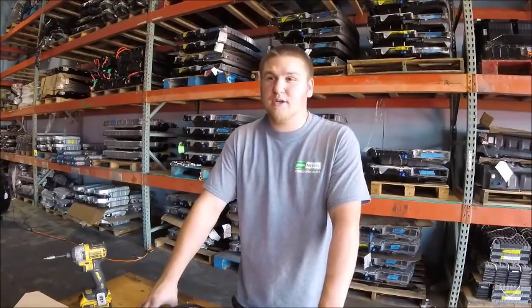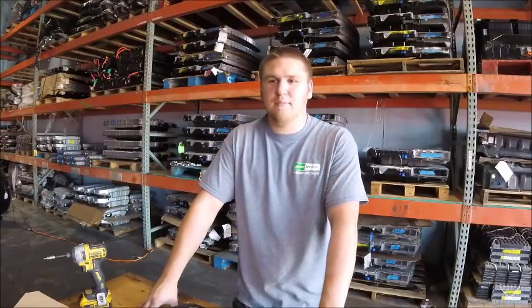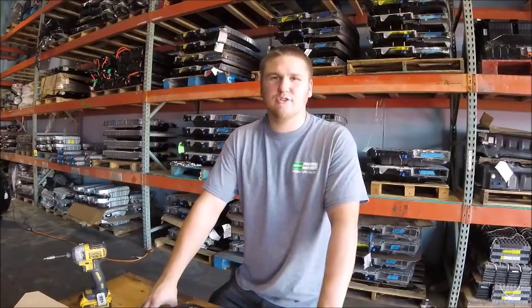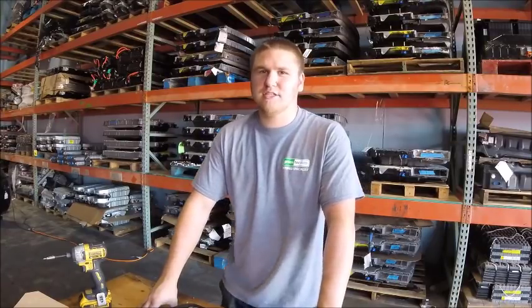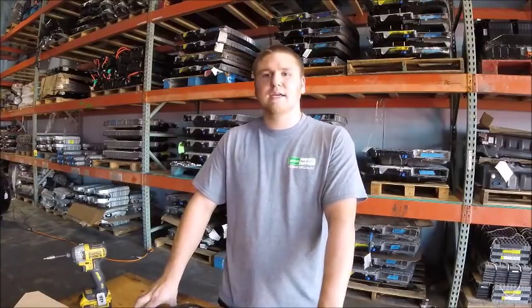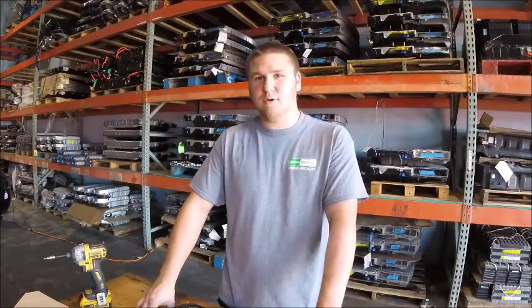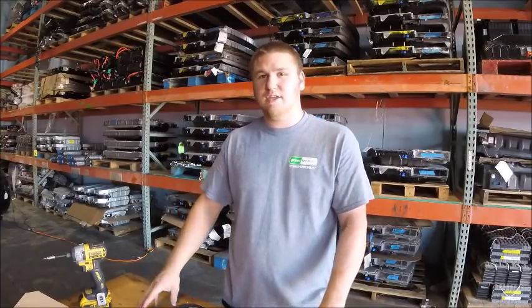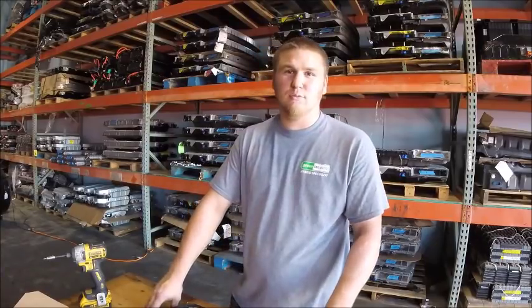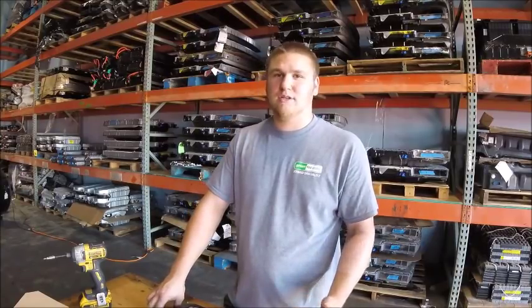One of the questions that I'm going to assume is going to be asked is, why don't I just charge them back up? There's a lot of videos on YouTube that I saw of people recharging Tesla packs and whatnot. And the thing to remember is that those packs didn't necessarily die completely, they just went below the recommended voltage in the vehicle, which would probably be around 3.1 or even 2.8 volts, which isn't good for the cell, which is why the vehicle stopped.